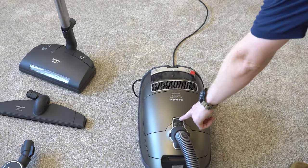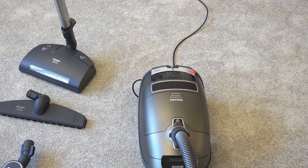The full bag indicator is right here and works like the gas gauge in your car — as the bag fills up, it's going to show half full or all the way full. If you're at high altitude, anything over a mile high, you might need to have that adjusted for your altitude. Bring it to your local dealer for details.